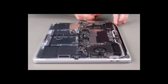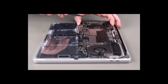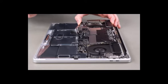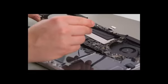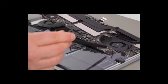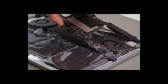Hold the logic board by the edges while you slowly and carefully tilt up the board. Lift the board incrementally and gently move cables aside to fully remove the board from the top case. When replacing the logic board, there are a few additional steps to transfer the heatsink and the EDP flex cable to the new board. Before installing the new logic board, you would also have to replace the Touch ID board since they're paired. Refer to the articles on this page for detailed instructions on those procedures.